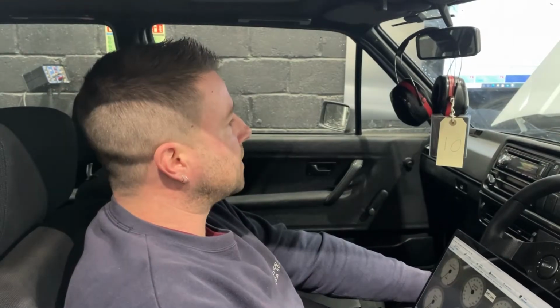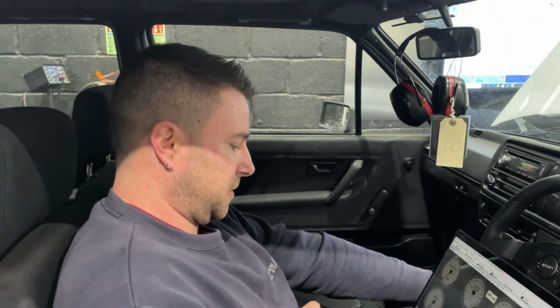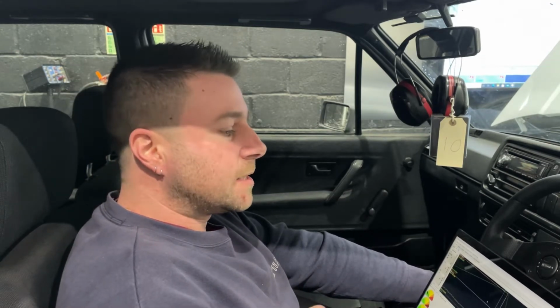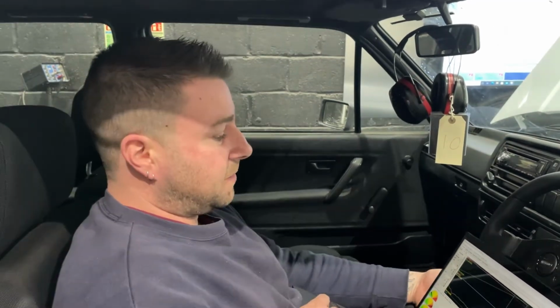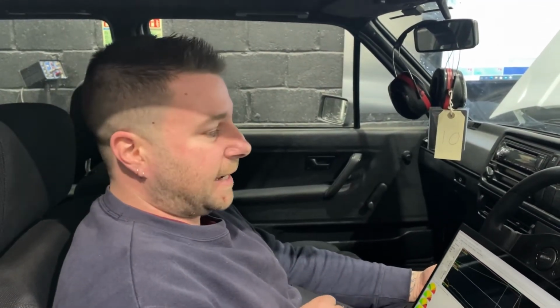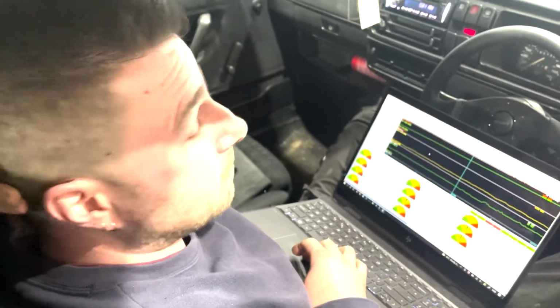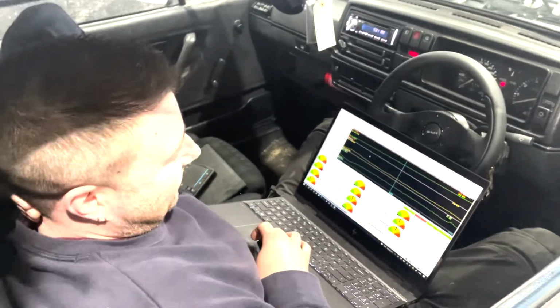I think I've just done my temp revision. We're now coming in at about 0.95 bar, tapering off to 0.65, sorry. So it's not loads of boost. I'm currently at 233 horsepower, 293 newton meters, I think. Just in the middle of cleaning the fuel up a bit, adding a bit of timing, changing the boost profile slightly, and seeing where we are. 45 degrees of advance.